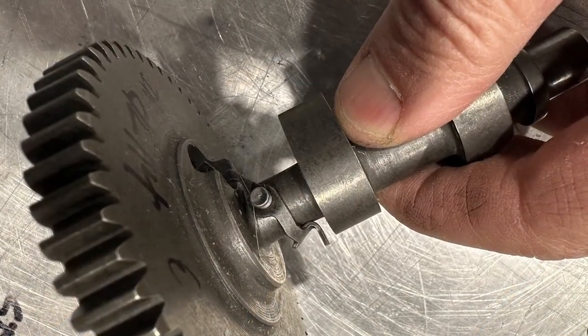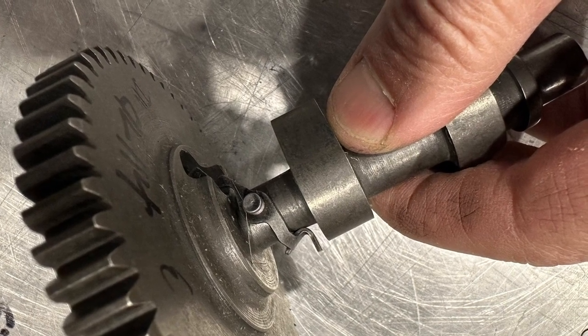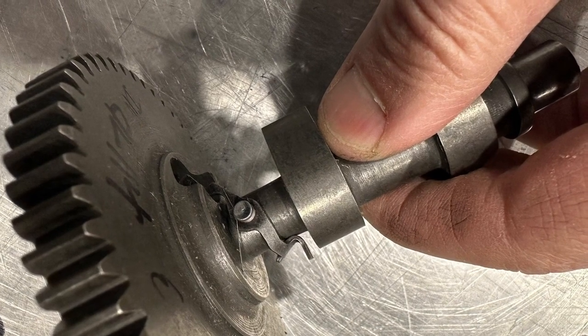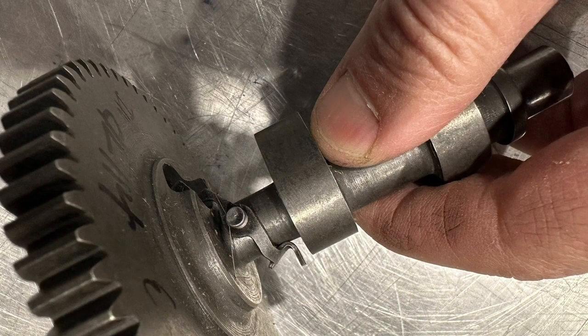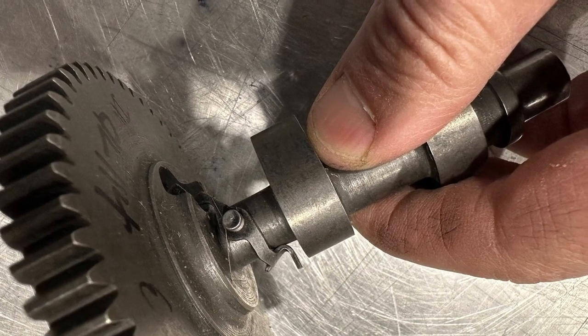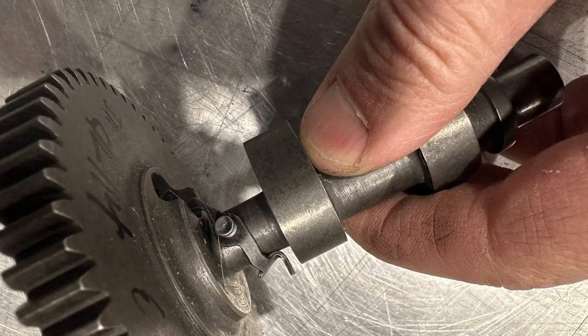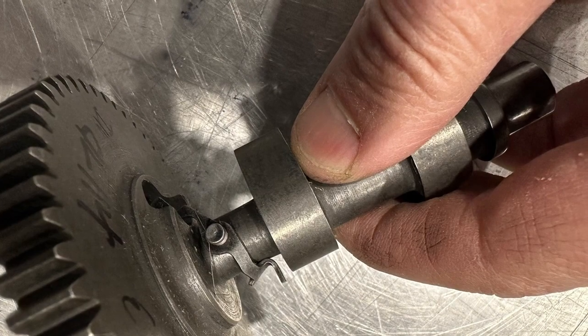Here's the cam out of the 206 and as you can see it's a highly polished, very precision made part. Briggs claims they take 3600 points on this cam and they are all the same. Why I have this picture up is you can see the compression release. There's a hole in the compression release and that is where this cam will twist and move right at that center hole.